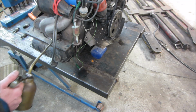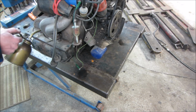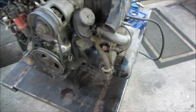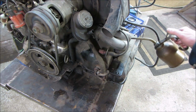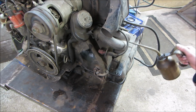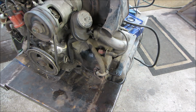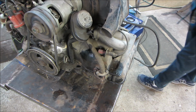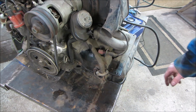Now what I'm going to do, just because I know it's going to sit for a while, is go with an oil can. Give a couple of shots of motor oil in each cylinder, just so that as it sits, any rust that wants to form on it gets a light coating on the valves, the jugs, the rings. Can't get it in the hole. There we go. So that'll kind of coat everything. I might bump it. I don't want to spin it fast. Are we still hooked up? It'll shoot the oil out. There we go. So now all that stuff's coated with oil.